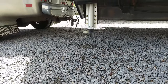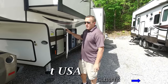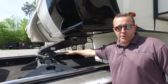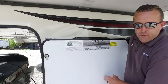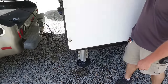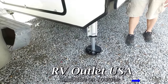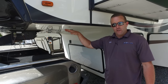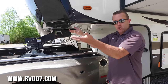All right, that's all the weight on the truck, so we're ready to haul. When it's time to unhook your fifth wheel from the truck, the first thing you do is put the jacks down. Do not unlatch the hitch — some people make the mistake of unlatching right away. You do not unlatch the hitch until the legs are on the ground. Sometimes people will run their front jacks down and as soon as both jacks hit the ground they'll stop — but this would be a mistake to unhook at that point, because there's still 2,800 pounds of tongue weight on the truck. If you unlatch and pull forward, when the truck comes out from under it, it's going to jump up because it will unload itself.